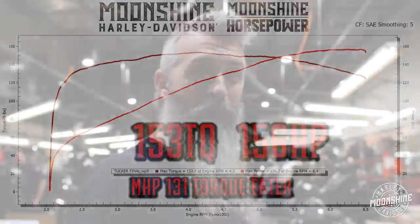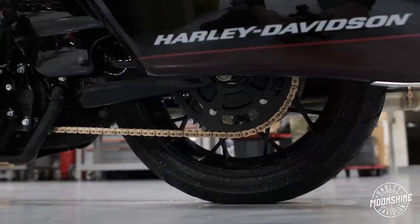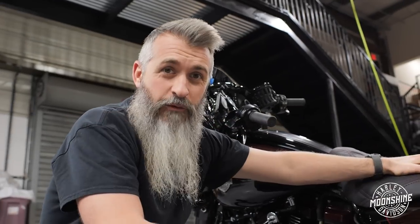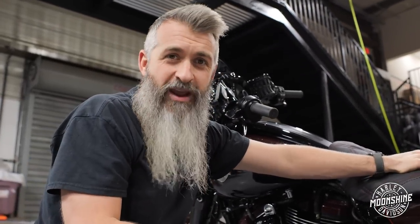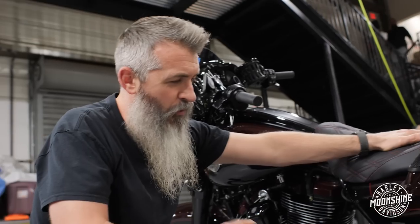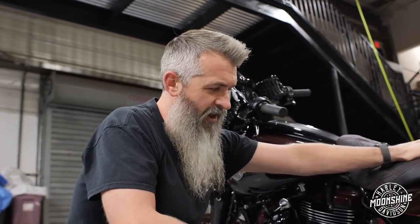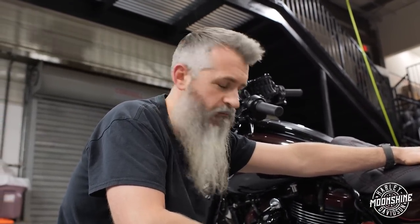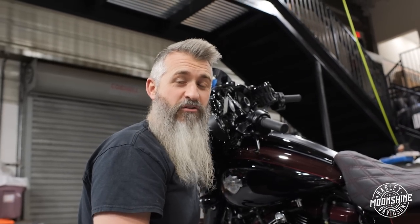Usually the chain drive, because they're a little heavier, pulls away a little bit of horsepower, especially when we have a brand new chain on her. This was dynoed with a brand new, tight chain because we know she's going to be breaking in. The first couple of hard rides on a chain conversion, you're loosening up the chain a lot — so if you get a chain conversion, you have a little maintenance to do. Under the first 1,000 to 5,000 miles, your chain is going to stretch, and you need to pay attention. A correctly adjusted chain is on point and doesn't make abnormal noise. If you let it wear, it will contact pieces down here because the Harley wasn't originally designed to have the chain. The cool thing about having the 530 chain on your bike is you're not worried about ripping teeth off or that guy popping. Go to the chain if you're going to be aggressive on it.